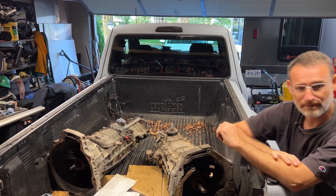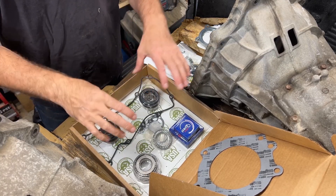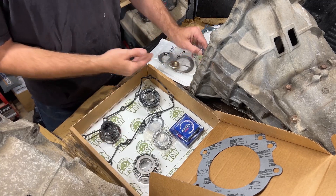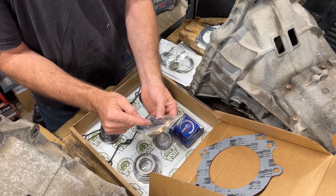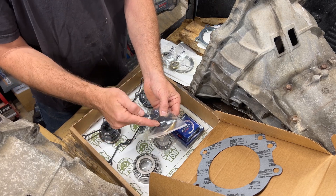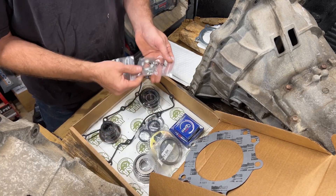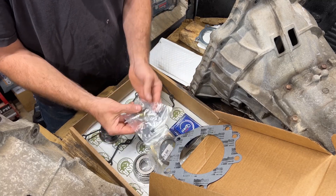Let me show you what parts I've got to do this swap. So here are our parts — I'll link them in the description. I've got a standard gear rebuild kit; I like these ones, they've got good bearings — Japanese bearings. Then I ordered a tower rebuild kit, which is just for the shifter to tighten it up. I also found my boot was leaking around the shifter, so fluid was coming out and it gives quite a bad smell in the cab. I also had to order a shim kit for the transmission and two lock nuts — the countershaft and mainshaft lock nuts.